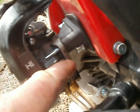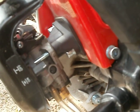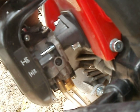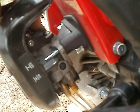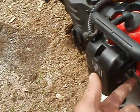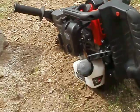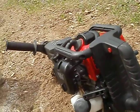I've done it before where I just take a Dremel and make a notch, and then you can stick a screwdriver in. But just not being able to get into the idle screw on top, I didn't. Usually need to keep on adjusting both to get a good tune. So I didn't cut those EPA type intakes on the engine block. I didn't cut those down, so I didn't make that modification. But it runs great. Ran great right out of the box.